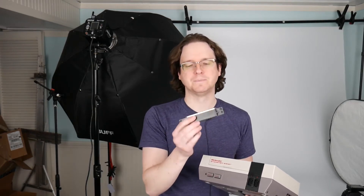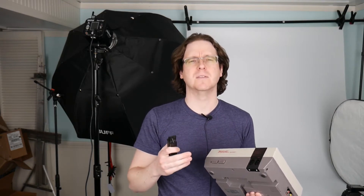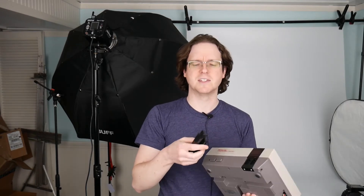Here is a replacement Nintendo — it's not my childhood Nintendo, a little upset with that. I thought I was going to have to replace the 72-pin connector, but it turns out it was just dirty. Corrosion can be an issue, but mostly it's just dirt and grime getting in there from blowing on cartridges, which you shouldn't do — shoving them in there, transferring the dirt and grime, and eventually the 72-pin connector won't be able to make contact with the cartridge and have it work.